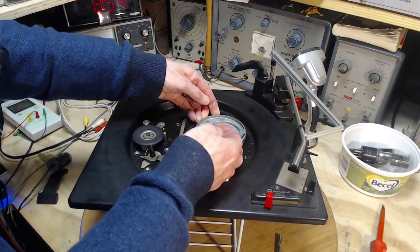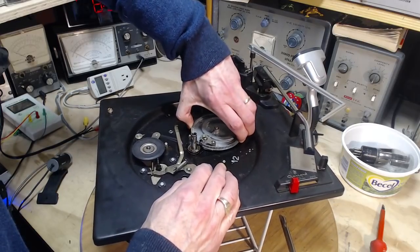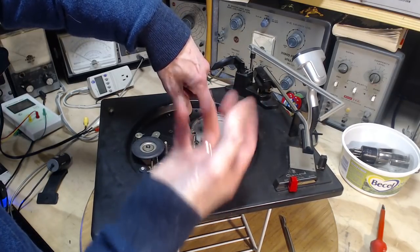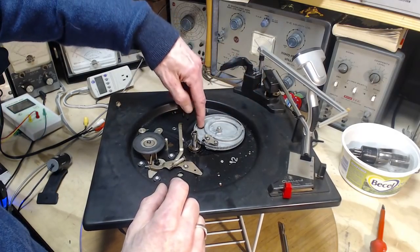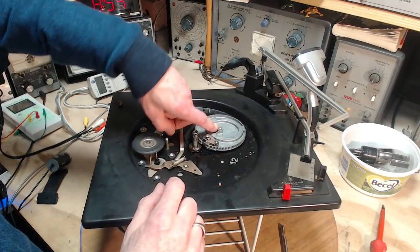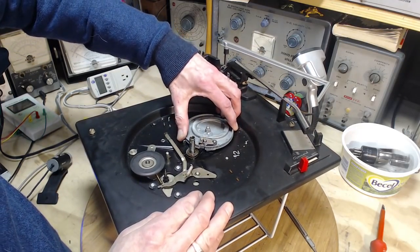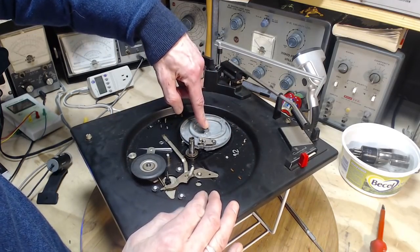Now let's see if we can lift this off. I just finished doing one of these record players. The issue here is this is supposed to spin on a shaft which is not supposed to spin — this shaft is riveted, bolted, screwed somehow to the deck. This should not turn. But what happens is the lubrication inside here, maybe because of the kind of metal they've used, really gets frozen in there. And when you do turn this, you can easily start turning this center post. When I move this, the post is going with it. So what I'm feeling in terms of resistance is actually the post and how it's fitted to the deck.